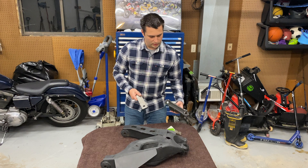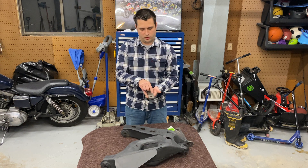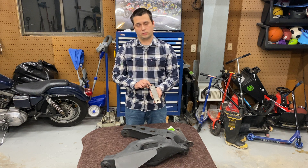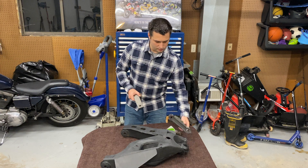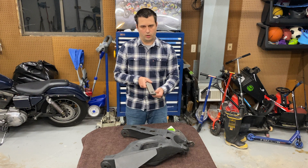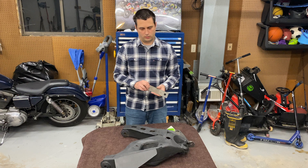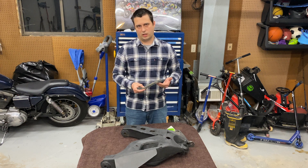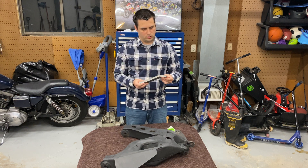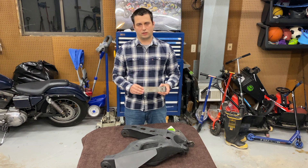You also get roughly the same width — an inch and three-quarter — so you've got an inch and three-quarter surface to work with at half-inch thick. It's laser cut. I also reduced the eyelets for the mounting: the factory ones were kind of loose at eleven-sixteenths, and I've brought this down to 41/64ths. It's cold-bent instead of hot-bent, put in a press using a 90-ton press and crushed to shape with a CNC bender. It's all laser cut and cold-bent by a CNC bender to ensure accuracy, so the fitment is nice and tight.